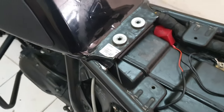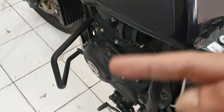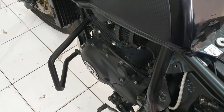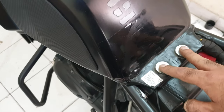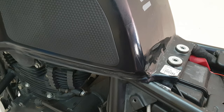For the next part, remove the seat and slightly dismount the tank as well. I have already done that; the side panels are out too. I have also ported the throttle body and injector manifold a bit along with changing the spark plug — I'll be posting another video on that. I just wanted to increase the diameter at the intake of the throttle body side. If you're just setting the idle, you only need to remove these two screws.